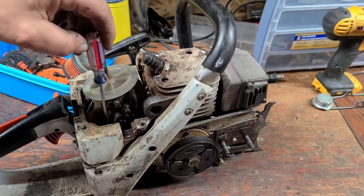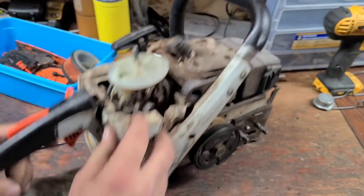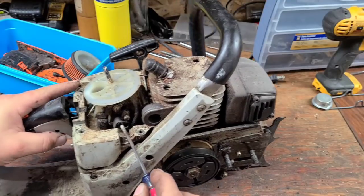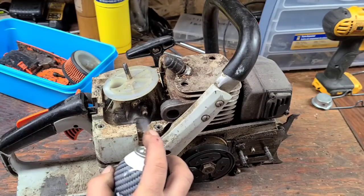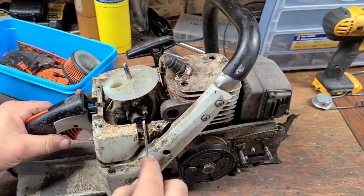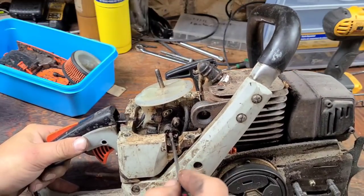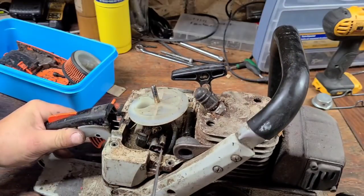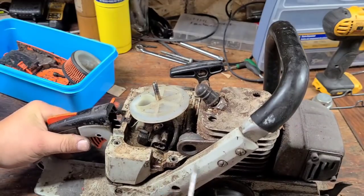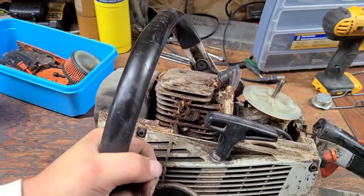It looks like this top cover screws to this base on the back here — it's a little loose, there's no screw holding this side on by the looks of it. Let's put a little carb cleaner in there and see what we can get out. This is normal stuff when you're working on saws — you're going to get ones that are real cruddy. In fact, a lot of these saws I spend more time cleaning them than working on them. So if you want your saw mechanic to love you, bring them a clean saw. The limiters were like smashed out of here — somebody probably took a punch.